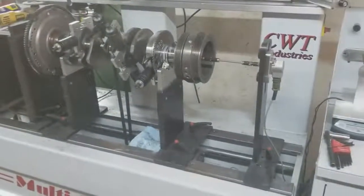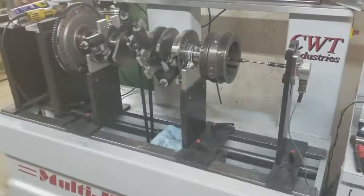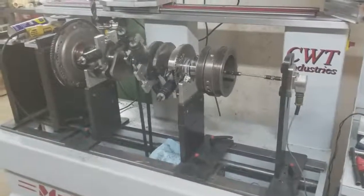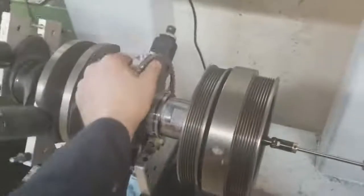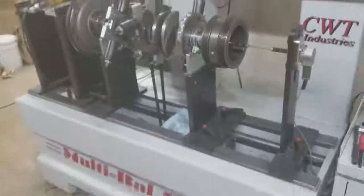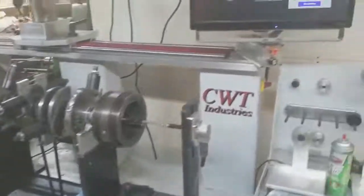You're looking at a 20 over or 30 over piston — there's maybe 15 grams difference on each piston. That means this side of the seesaw doesn't weigh enough; this side right here is not heavy enough to counteract the other side now, because you've added more weight on the opposite side. So it's extremely important to balance.